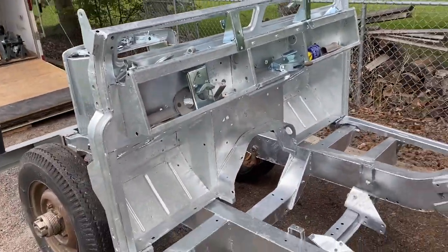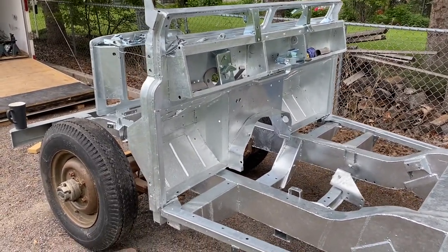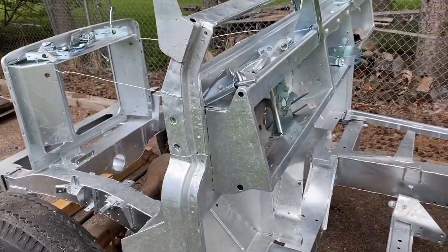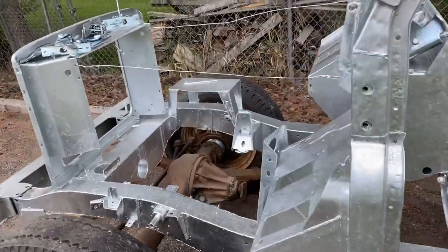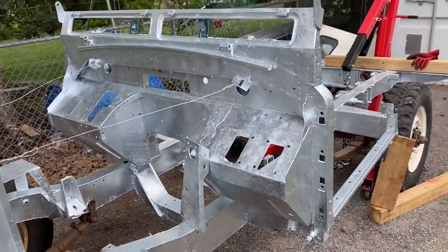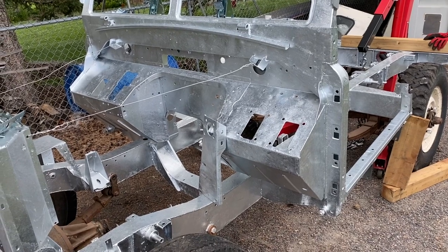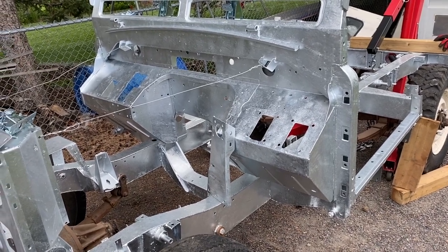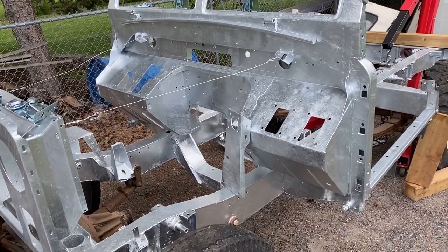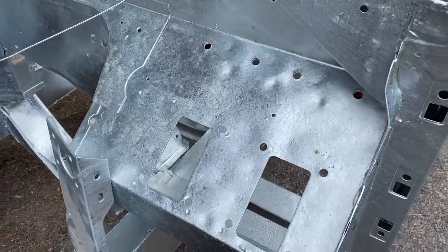You really have the ultimate in durability when you galvanize it. Instead of spraying, painting it and putting wax oil everywhere — which is a wax you can inject into the frame — the zinc gets everywhere. One of the problems is that it's very high temperature, around 700 degrees Fahrenheit or so, and so if you have thin sheet metal, it can warp it.